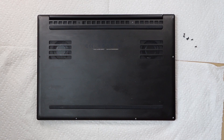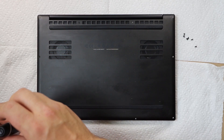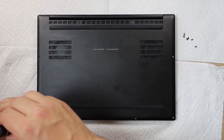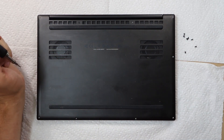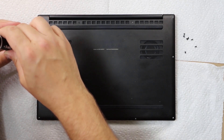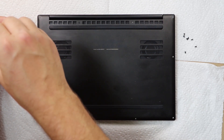This is M.2, so hopefully it's going to be a little plug-and-play action, not too much trickiness here. The biggest headache is going to be the fact that I just stripped that one bit — the rest of these screws should come right out no issues. But I do just want to say: be really careful when you're taking out these screws. They come out with T5, the Torx head — those star bits. They don't come out too difficultly, but you can apparently strip either the screw or the screwdriver bit pretty easily, so be careful about that.